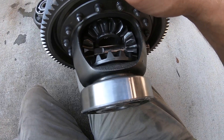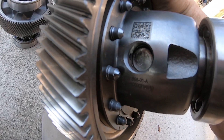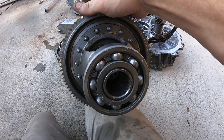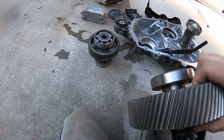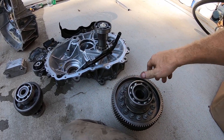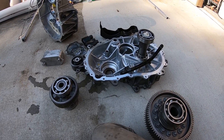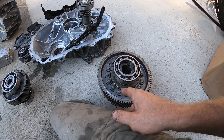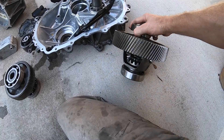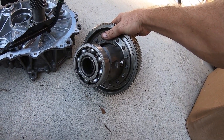I completely overlooked that. It just sheared that keeper pin right off — that's what happened. At first I thought it was some catastrophic bearing failure, but no, it was just a keeper pin. It's hard to say — at 20,000 miles on a vehicle when it got into a front-end collision, how that front-end collision affected a keeper pin, and this happened at a hundred thousand miles. I think they better look a little closer into that keeper pin, or maybe they've already fixed it — maybe they put one on both sides now. It seems like they should. But no, they only pinned it on one side.